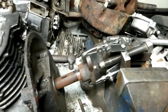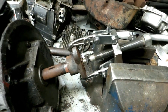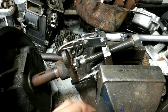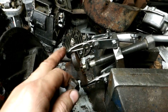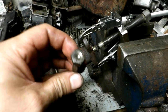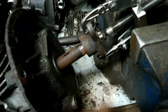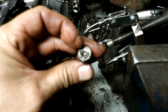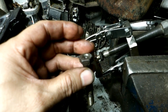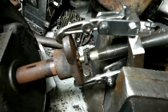Just having some fun removing the blade mount off of this '96 Briggs. I've got my homemade two-jaw puller there — it was a three-jaw cheap one, but the thread gave out. So I used the jaws and connector pieces. The first thing I had to do was take a regular 3/8 fine-thread blade bolt that screws into the crankshaft and drill a cup — or cone — in the center, so that the bolt on the puller centers on that. That's what I push against.